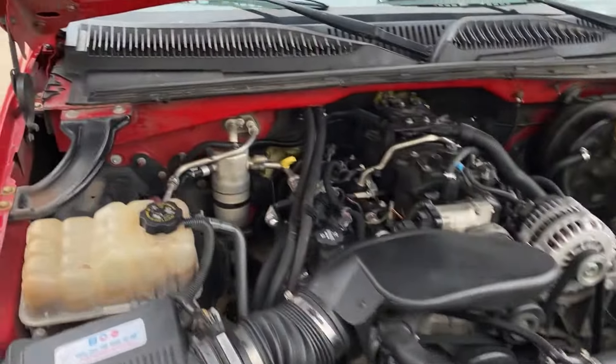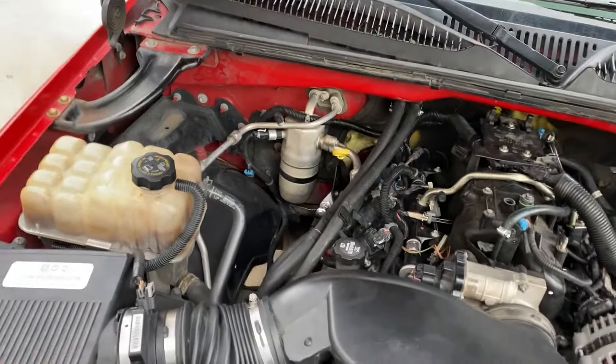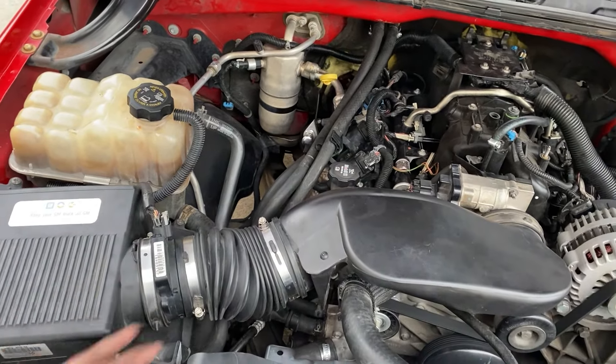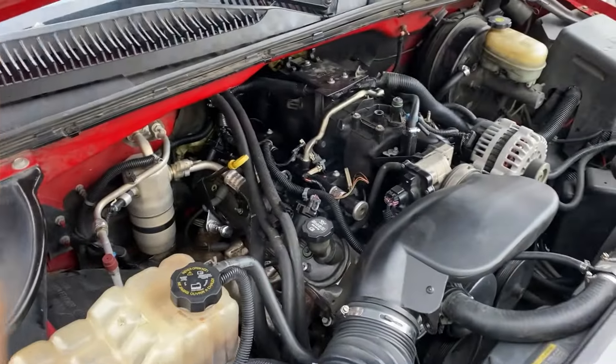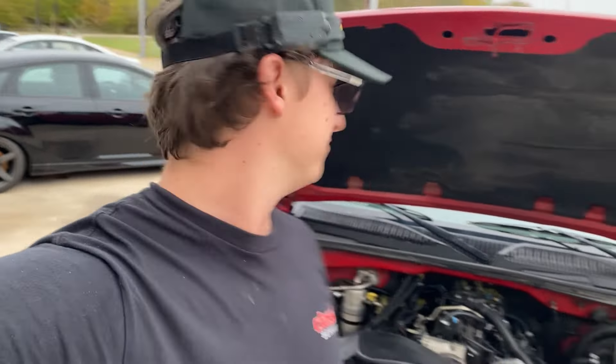After a couple of hours it is all back together. Just fired it up, everything was good. I had a little bit of a leaky fuel line so I tightened that up. I've just been heat cycling it, getting the coolant level down, refilling it, trying to bleed all the air out of the system — and the new Brian Tooley Racing head gasket is doing well. Can't thank those guys enough. They have everything you need if you blow a head gasket on your 99-06 Silverado, Sierra, Yukon, Tahoe, whatever it may be. Go over to BrianTooleyRacing.com and order the same parts I did: head gasket, head bolts, exhaust gasket, and coolant from your local auto parts store. I'm going to heat cycle this a couple more times to make sure coolant level stays up and there are no more leaks, then drive it home.